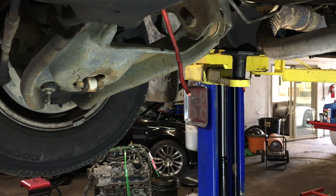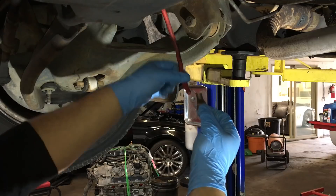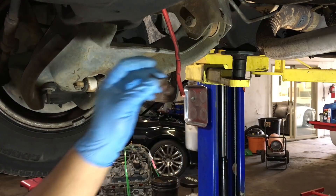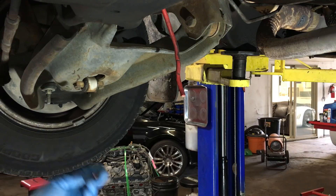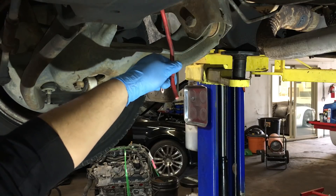What I did was replace the cable and repair it with one of these copper lugs or terminals. At the time I was a pretty firm believer that soldering these connections was good enough — basically taking the copper lug, filling it up with solder, and pushing the cable in. Once the solder cools and hardens, the connection becomes pretty strong. I've done countless numbers of these, and sometimes if it was easy enough I'd use the crimping tool, but a lot of times when repairing on the vehicle it's kind of difficult to use.